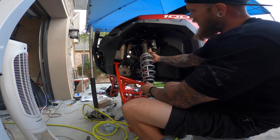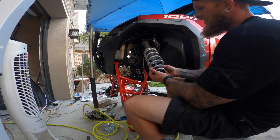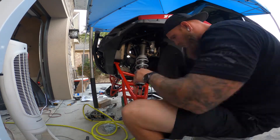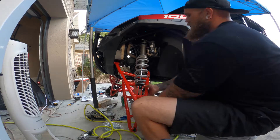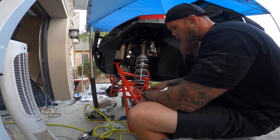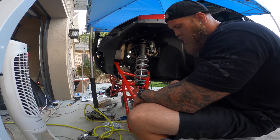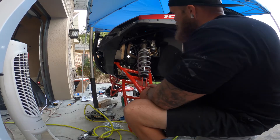I just loosened this all the way up — makes it a hell of a lot easier to compress this shock, because you've got to compress it a little bit. At least I did on the other side. It's been about 20 minutes and we got both of the control arms on. Obviously the ball joints were already pressed in. That didn't take too long — it was a battle, don't get me wrong, but if you have the right tools it'll probably be easy. It wasn't easy for me, but I got them in.